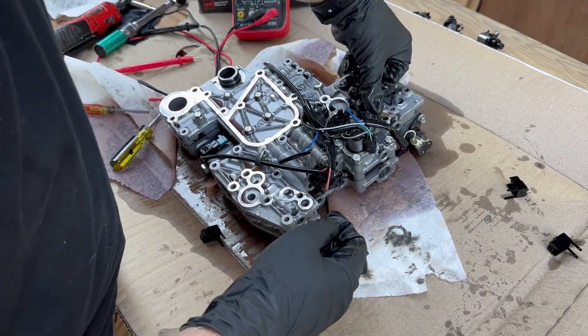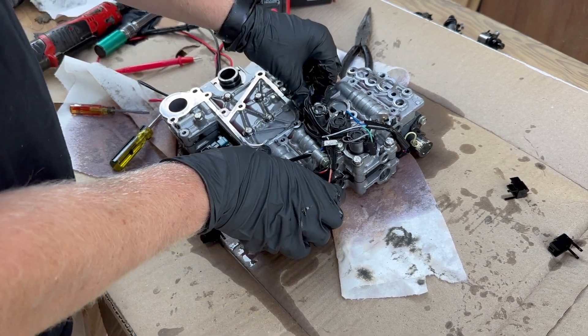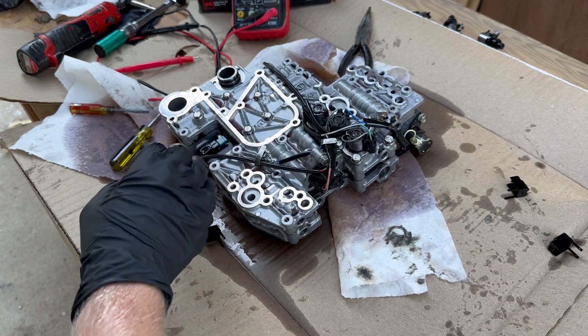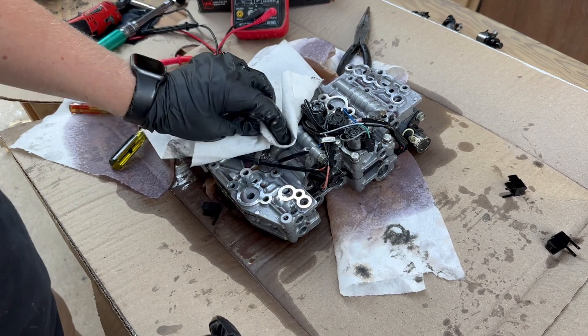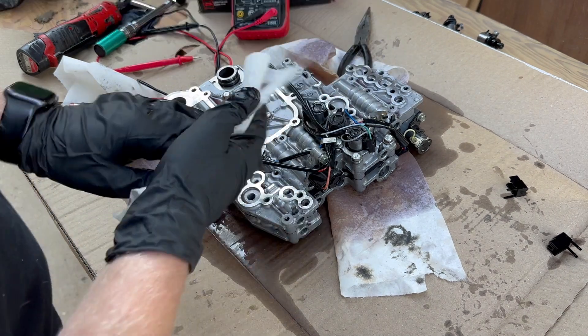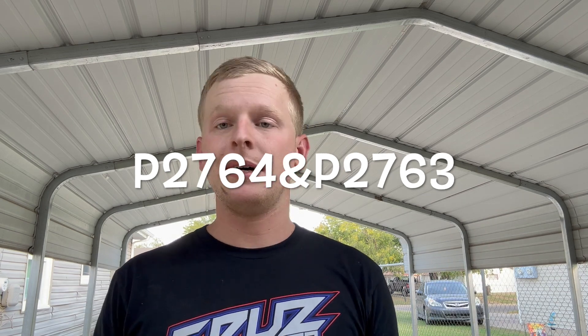All I'm going to do is bend these tabs back down so they're holding the wires they're supposed to hold. And there — that is how you change out the solenoids in these valve bodies. I'm going to throw this bad mama jamma into the transmission tonight and fill it up tomorrow once the gasket maker dries. It's that easy. If you're confident removing the valve body, you're more than capable of swapping out these solenoids — super easy. If you have these codes, it's the torque converter valve body solenoid lock-up. It has those three solenoids; it's honestly the first one with the green wire.